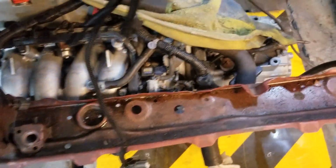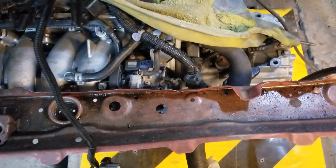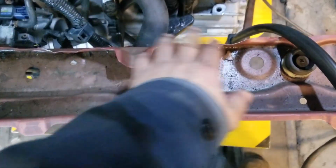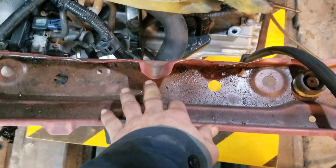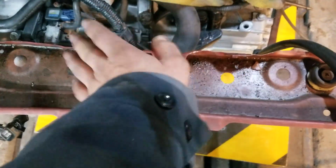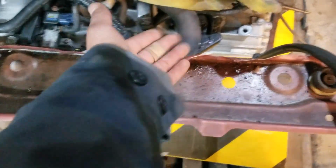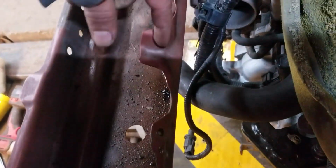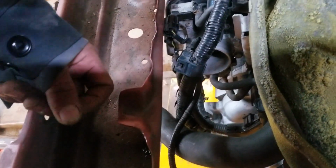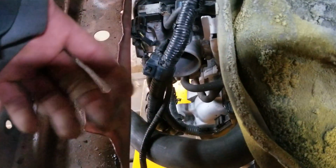Now, the radiator support, you have to notch also, because all this right here for the stock 1.5L is just all in the way. So you don't want that in the way. You want to bend it forward. I didn't want to cut it yet, not yet. I'm gonna trim all this right here because I want better fitment. Well, I want it to look good.